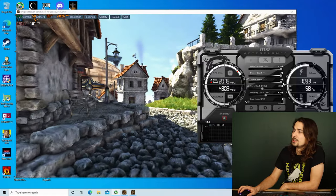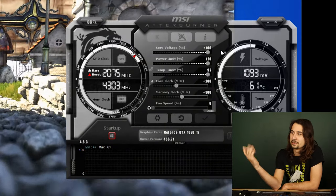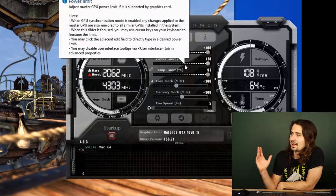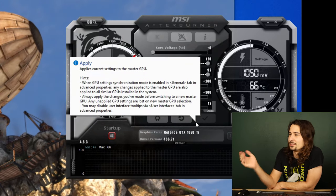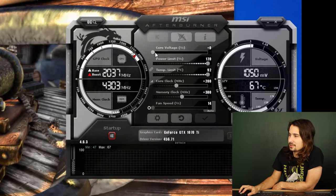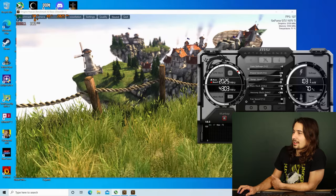We're throwing a whole 1,100 millivolts at this thing, and it's fine. The key here is that percentage number is completely fake. If I take it down to zero, it only drops 30 millivolts. The percentage slider on MSI Afterburner is a complete load of crap because not even MSI knows what the card will multiply off of it — it's very bizarre and kind of misleading. Most people see 100% and think they're doubling the voltage to their card, but it doesn't actually do anything. And setting the voltage slider to zero doesn't make your overclock any more stable either.